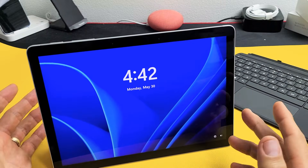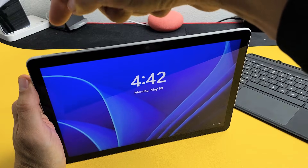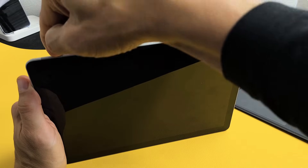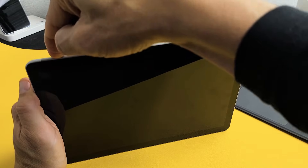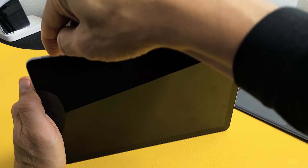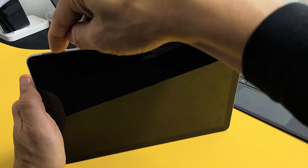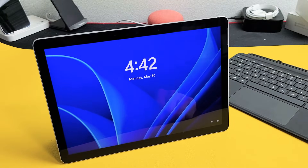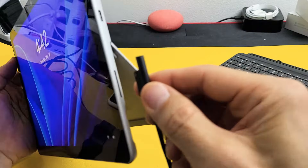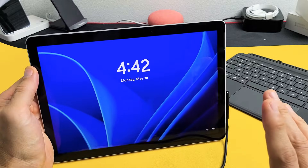If your screen is still black, the next thing we're going to do is locate the power button and spam it — pressing in and out like this — to go ahead and get it unstuck. Maybe it's stuck or jammed, or maybe you've got lint in there, or coffee, or soda, or even water or lotion. So go ahead and loosen that up. Now we're going to grab the charging cable and plug it in. As soon as we plug it in, just make sure that the white light comes on so we know it's charging.